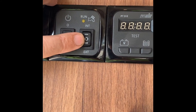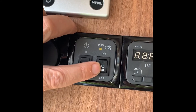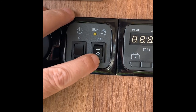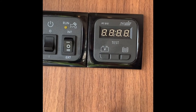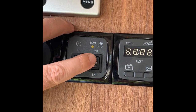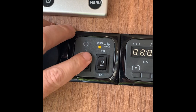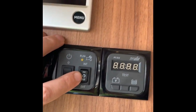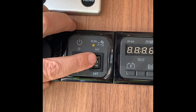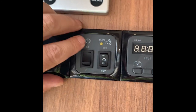To fill up the internal tank you need to come from an external source. Connect your aqua roll of 40 litres, press external with the pump on - that will pump the water from the aqua roll into the internal tank, which is located under the bed. Then to use that water, press internal. The middle setting gets water from outside without using your internal tank, and you can use your internal tank by pressing INT, but you need to fill that tank up from an external source first.